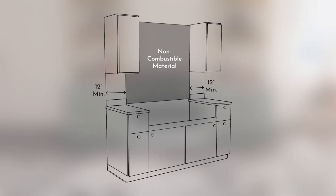The minimum clearance of the unit with the adjacent wall is 12 inches on each side. The minimum clearance of the working areas adjacent to the range top is to be 18 inches between the bottom of the wall cabinet and the countertop. The required depth of the wall cabinet is 16 inches maximum. The minimum width on each side is to be 12 inches. The opening between a 4-inch high backsplash is to be 48 or 36 inches for a 48 or 36 inch range model respectively.